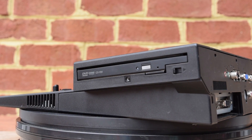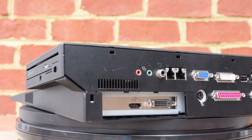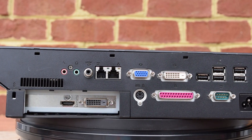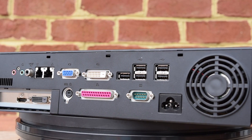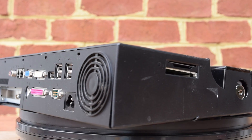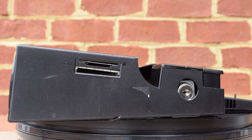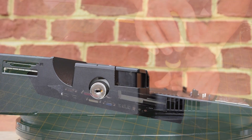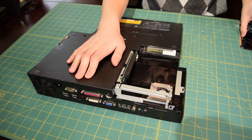So yes, you're watching a video pretty much entirely about a docking station. The 2503 looks like every other black brick docking station of the era — it has a docking port on top, a key lock to the side, and a ton of I/O to its rear. Overall, it looks pretty dull and boring. But look closely and there are two distinct things you will notice. One, the docking station has an integrated power supply, which is a bit odd. And two, there's an empty compartment towards its back — that compartment can house a half-height, single-slot, desktop video card.